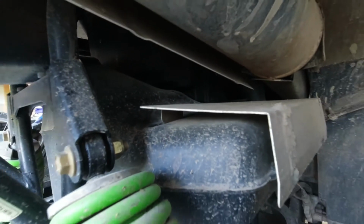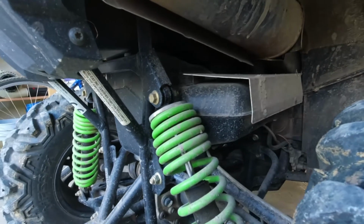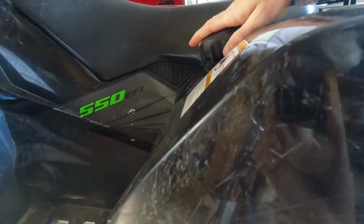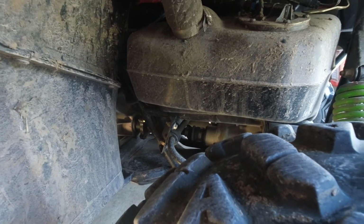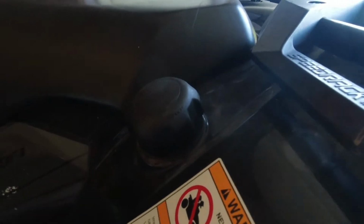So if your riding style takes you swimming, you get it to the racks, then you should consider putting a vent line on it to the pod or by the gauge up high, or get a cap vent that will vent it. So I hope that answers your question. No, there's no vent on these gas tanks. If you want to add one, you'll have to run a line up to the pod with a barb and some tubing. But yeah, let me explain this pressure underwater.